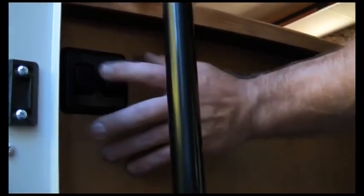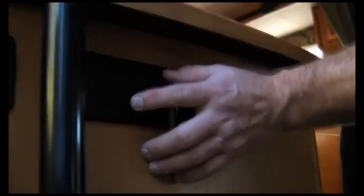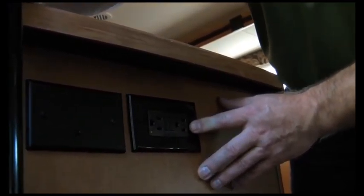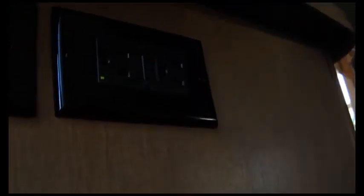You have two switches typically in a doorway. First one's a porch light; second one's an overhead light when you come in in case it's dark. We've got our TV antenna booster switch right here — that needs to be on if you're going to try to use the TV antenna. I don't recommend that when you're camping; take some DVDs or visit Redbox. This is a GFCI breaker — all of your outlets for the entire coach run through this GFCI breaker. If you lose power to your outlets, hit the reset button. You've got a fire extinguisher just inside the entry door.